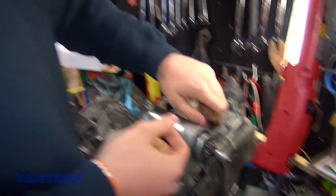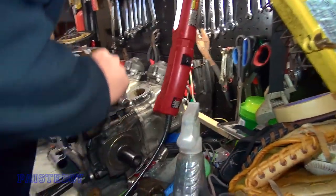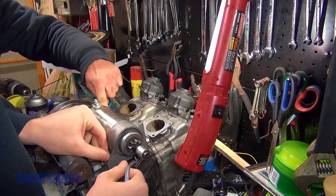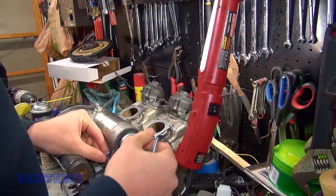The other thing I was thinking — should we put like a sleeve in there? Because the hole on the starter is bigger than the bolt. Like a bushing or something? I don't want the starter to be rattling around. There probably wasn't one initially. Because when you only had two bolts in there it was just moving around — that's true.